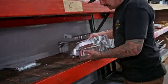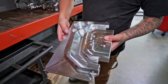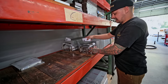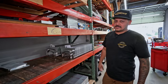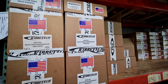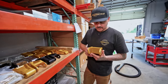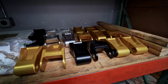We've got some Tacoma upper arms over here — you can see this big angle we added for more room for bigger shocks and reservoir hoses. A bunch more room added, with the tool paths — that's step one, step two will come out as the finished part. We've been machining TRX parts for what seems like forever — done around 40 or 50 front kits and rear kits. Some are coming back from anodizing, a bunch have already shipped out. If you have an order in and haven't got it yet, they're all done — either at the anodizer or in shipping. We also made some more shackles, basically sized for every 2500 but they fit on Raptors, F250s, and anything with a three-and-a-half-inch spread — seven-inch eye to eye. Kevin updated the program, added different tool paths, and increased efficiency on those.